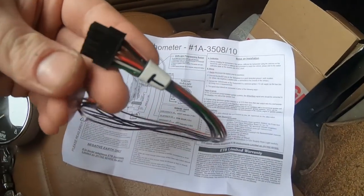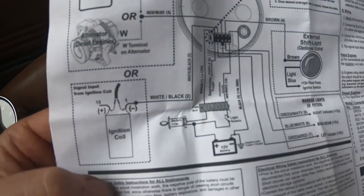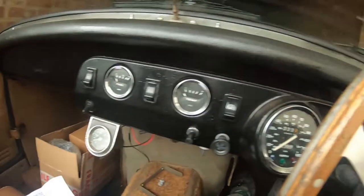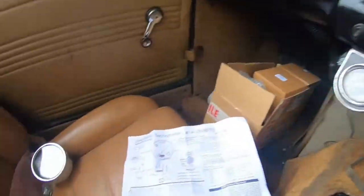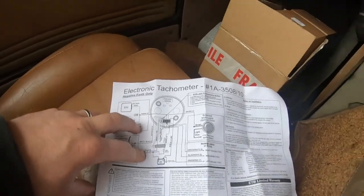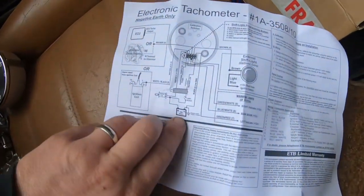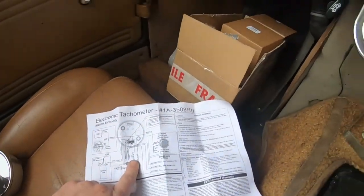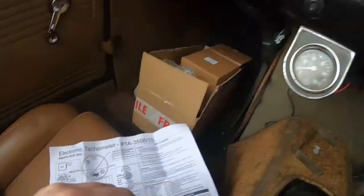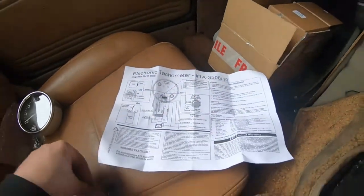The kit is quite good — it comes with a little wiring loom with the plug for the gauge and a good wiring diagram. Most of the wires I've already got here. The white and black wire is the feed to the tachometer, so I know I've already got that one. There's a green wire which is fused from the switch — I need to check, but it'll probably be the green wire there. There's also a light switch wire for the backlight, and a ground wire which is already there. I think it's just a case of drawing the wires onto this bit of loom.